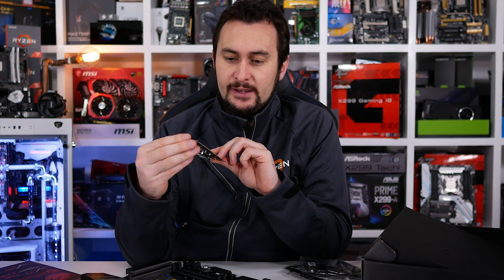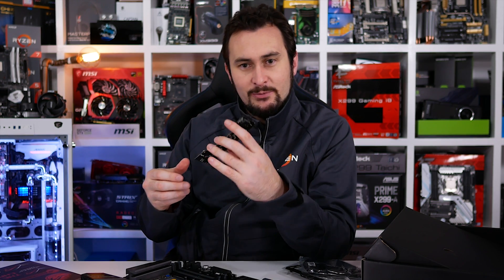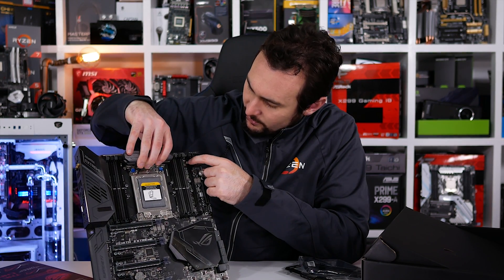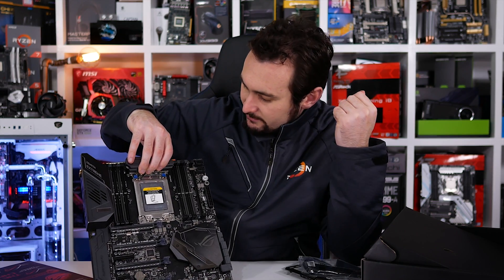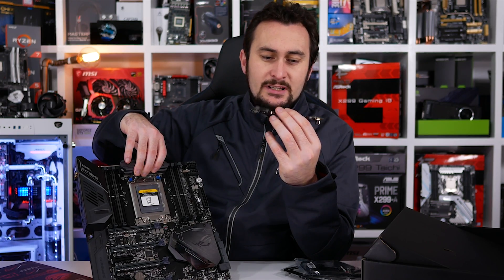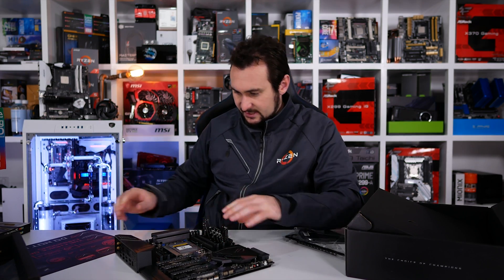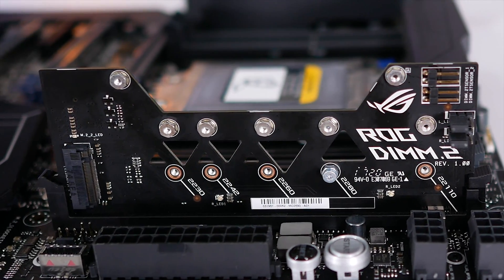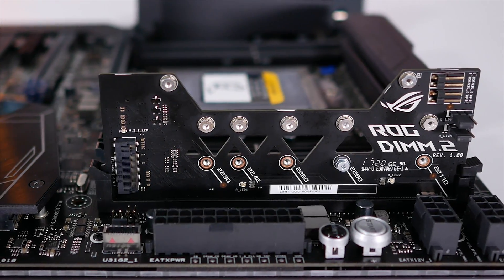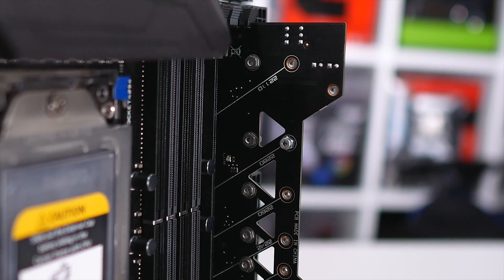I spoke without actually checking everything out, but that's what this unboxing series is all about — I know pretty much nothing about the product going into it. I was wondering about this extra DIMM slot here with a weird little bracket that stops you from installing memory. Wonder no more, because this cool little adapter is what you plug into there. Pop the memory in — clips into place — and that gives you a pair of M.2 slots, one on either side of the card. That will support multiple cards, and there are a couple of thermal sensors built onto it. Very cool indeed.